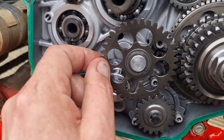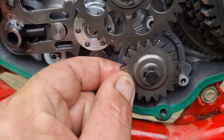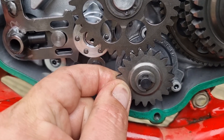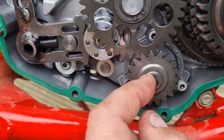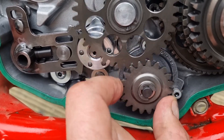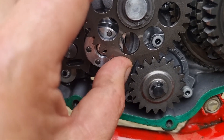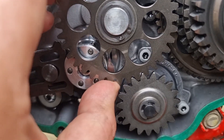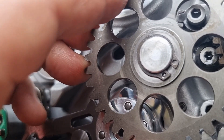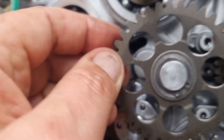Here are the metal gears installed in replacement of the plastic ones. As you can see the difference is miraculous - there's absolutely no play whatsoever in this one. That's just the shaft moving in and out of the oil pump but there's absolutely no play. It was a very snug fit on here. This is the one that drives the pump - there's a cross piece behind here which runs through the shaft to drive it. And this one, although there's still a little bit of wobble, it's nothing like the amount of wobble that was on the plastic gear - literally next to nothing.